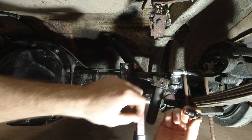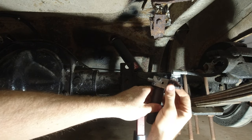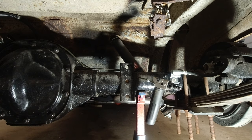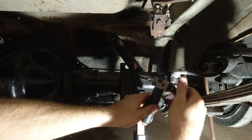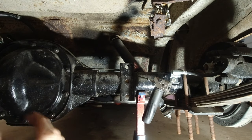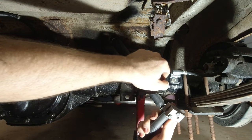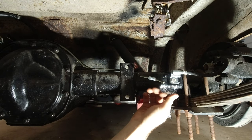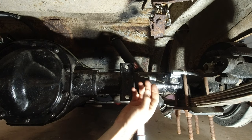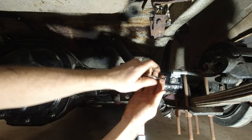Then you flip it over, and this will flatten it out and make it nice. Thread that all the way in, and then tighten it till it's bottomed out. And that's bottomed out. Loosen it, and it'll come out all the way. And once you got that, you can loosen these. Almost there, maybe. There we go. Loosen it that far, get over the flange, and voila, you have a perfect double flare fitting. Flare, flange, fitting, whatever. I bent that a little bit.